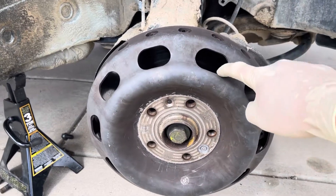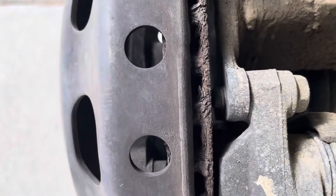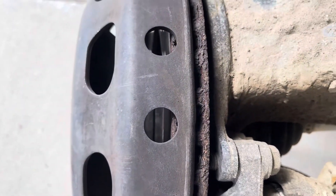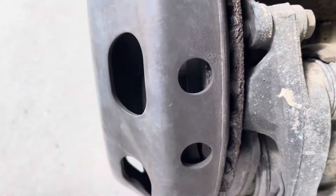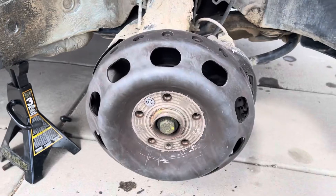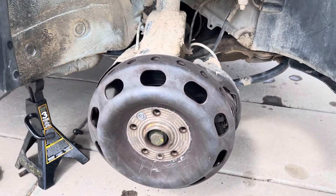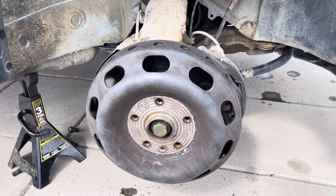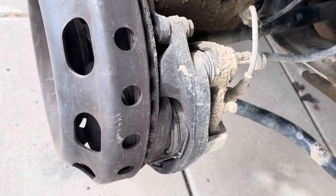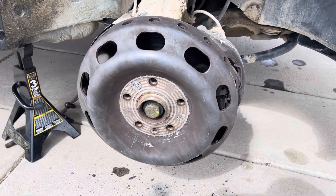That lets it have almost the full diameter of the inside of that 15-inch rim. Kind of a weird design — these pulsate a little bit, and as you can see right here, the gap between the venting and the face of the rotor is really thin, so I'm thinking these are probably past spec. I'll have to pull these off and measure them. Anyway, I just wanted to do a quick video on what these look like since I'd never seen them before. They work like a standard disc brake setup — just kind of inside out. Thanks for watching.